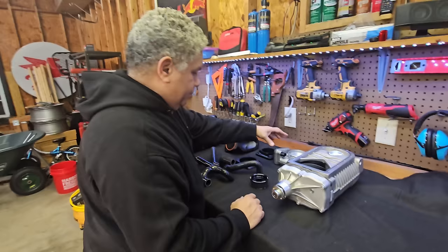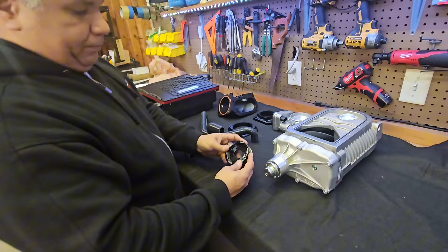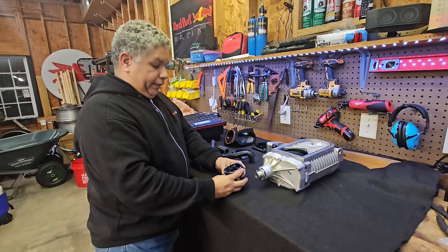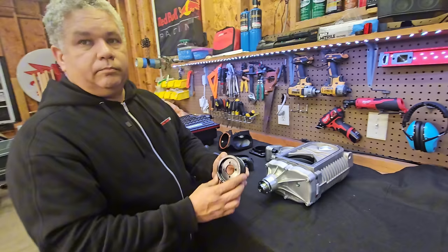Moving to the front of the blower — this is exciting because it's just come together in the past few weeks. At first I was going to go with standard aluminum or stainless steel pulleys, but seeing the type of loads and RPM this motor runs, I knew we were going to have belt slip issues given how the OEM belt routing is. On our initial testing working with 034, we found belt slip issues and quickly addressed them with the help of CP GripTech pulleys — they built a custom size pulley for this.